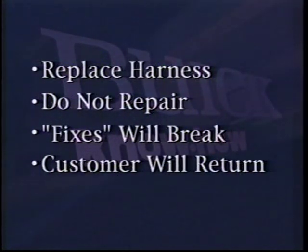If you do find a leak in a harness, replace it. Do not repair or solder in sections of wiring. These types of repairs break after a short time. The customer will be back with the same problem. Save yourself and your customers the aggravation. Replace the harness.